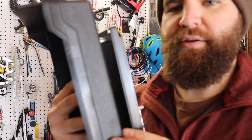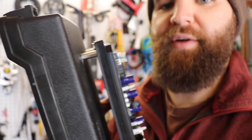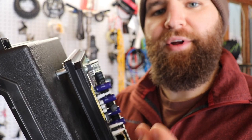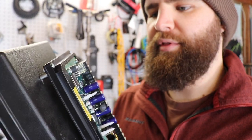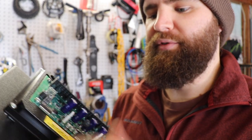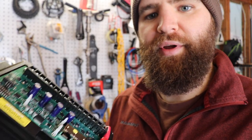Alright, I got it done. You can see that I drilled four holes. They called for 5/16s, but I went a little bit smaller because the diameter of these posts are 5/16s, so I wanted it to sit up a little bit. One important thing is don't over-torque these bolts or nuts or screws, because it's just holding a circuit board. This doesn't need to be very strong — it just needs to be held in place.